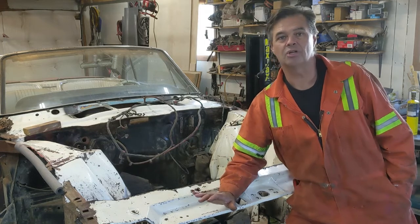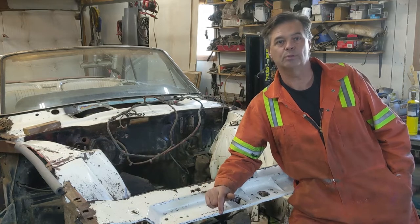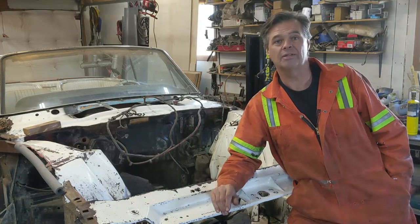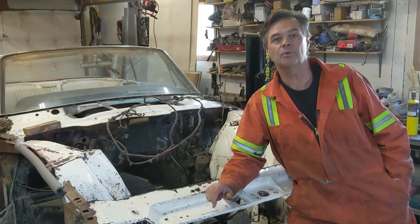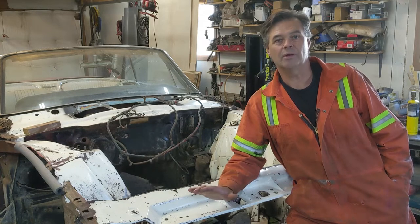And the front suspension is gone. I took the driver's side off camera because it's the same procedure as the other side. I did have a lot of trouble with that front strut nut though. Just a little heads up, if you're doing this stuff, you'll probably have to heat it. Keep a means to put the fire out real close at hand because it does flare up on you. Anyway, that's what I wanted to talk about.